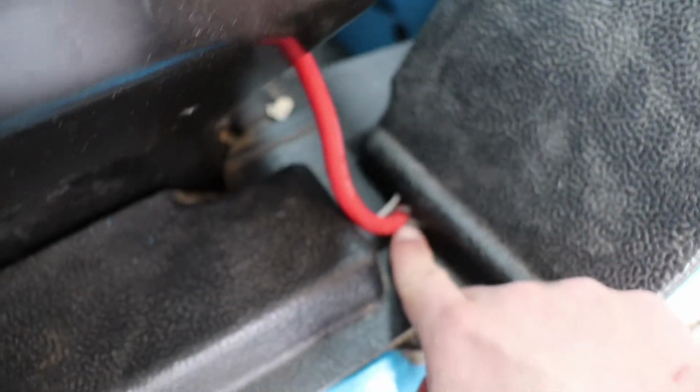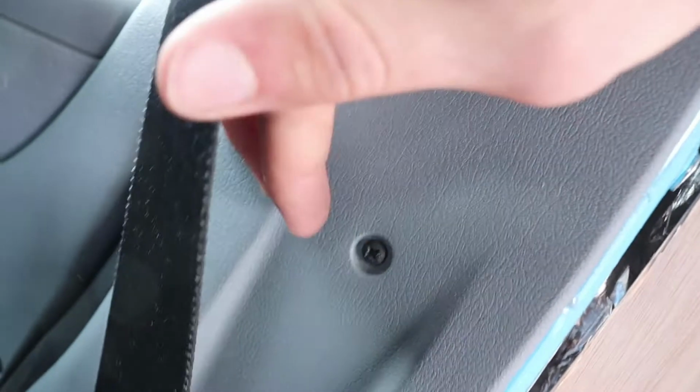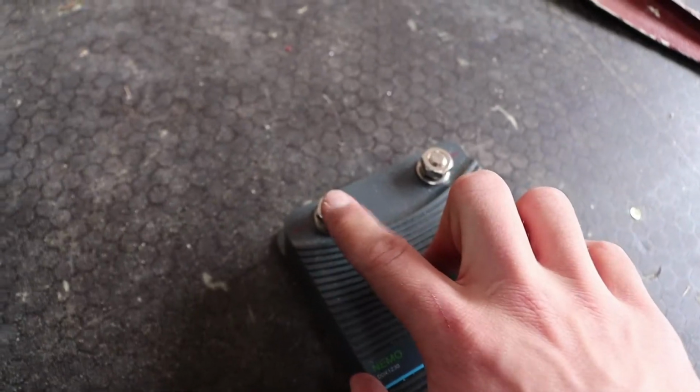As you can see, I just slit a bit in here with a Stanley knife. That runs up here and it runs up this corner. That's the only place it would fit, up that corner of the trim. I just removed it by taking that screw there, 2 screws there, and the trim basically fell off. We have ran the ignition wire, which will crimp to this one, labelled ignition. We have ran live to the starter battery down the trim here. That will slot onto there.